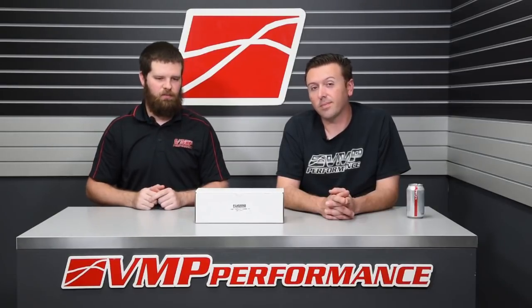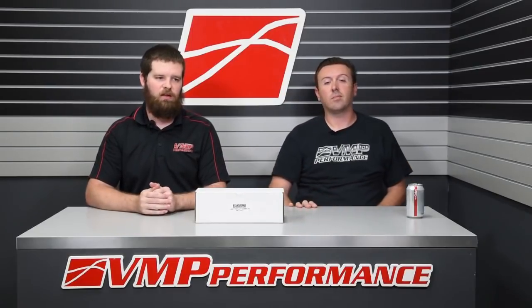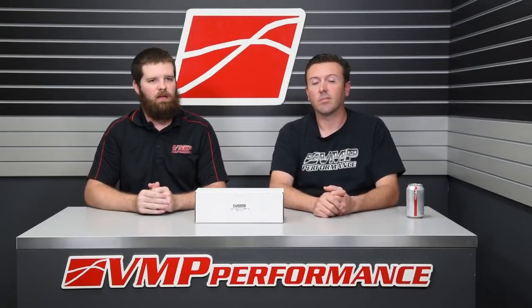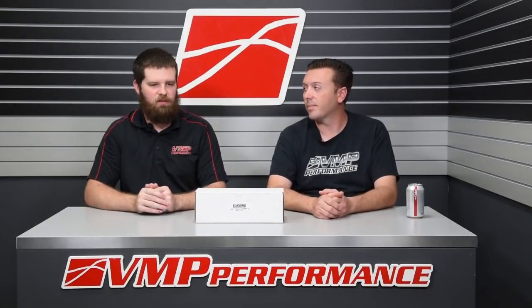I like to think of it this way. If budget build are the first words out of your mouth, don't put headers on a 5-liter car. Not until a very high horsepower level do they really net a really good dollar per horsepower figure. Like on a mild setup, 600-700 wheel, they're in that lower end of gains at around 10-20 horsepower.